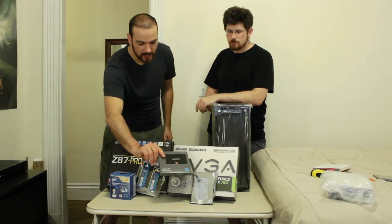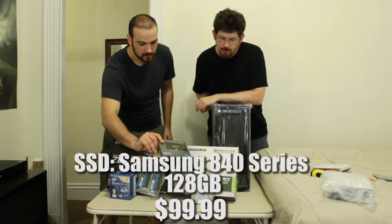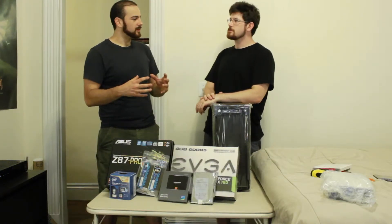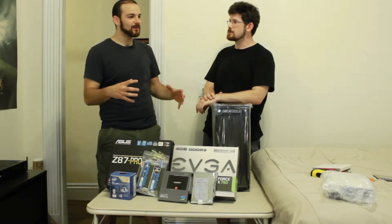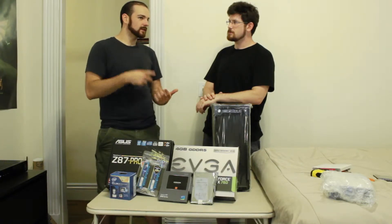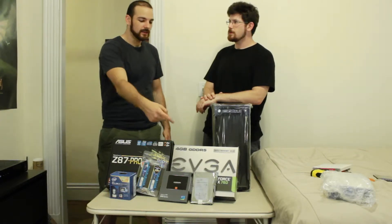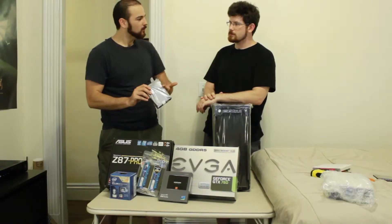For hard drives, we've got an SSD - 120 gigabytes. That's good for a boot drive. That is the one thing I wish I had gotten a bigger version of, because everything you put on that drive boots up immediately. You can see the difference - it's not so much the processor or the RAM, it's the solid-state drive. It has to load all these assets from your drive, and traditional hard drives are the only things with moving parts still - like a record player, literally.